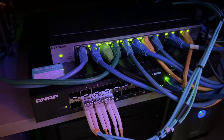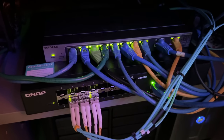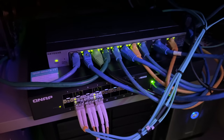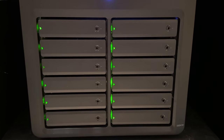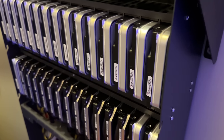In my shop, I run two switches. First, there's a Netgear switch with two 10 gig ports and eight 1 gig ports. I connect one of the native RJ45 10 gig ports back to the data rack, and one on to a 25 gigabit QNAP switch. The second switch features a single 10 gigabit downlink connection and then 16 25 gigabit SFP28 ports. Those ports connect to my Mac Ultra Studio, my Storinator server in the closet, and my desktop Threadripper PC, so they can intercommunicate at 25 gigabits amongst themselves and then at 10 gigabits to the rest of the entire LAN. My Synology NAS is connected at 10 gigabits, and I do my video editing directly on it. Soon, I'll transition to working directly on the Storinator, which is connected at 25 gigabits.